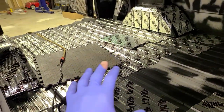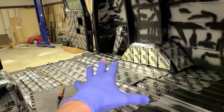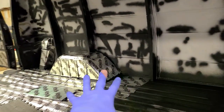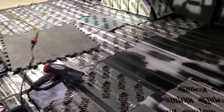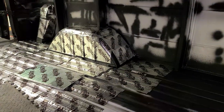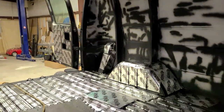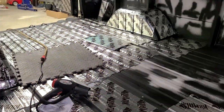Now I'm working on Kill Mat, which is 80-mil sound deadening mat. What it does is stop that jingling when you slam your doors or when the van bumps around on streets — also great if your radio bass causes rattles. I'm putting it on the roof, the walls, underneath my chairs, and on the wheel wells. I wrapped the wheel wells really well all the way around. I got one back door done and when I close it, it doesn't have that hollow metal sound. Highly recommend it — I'll link it in the description.